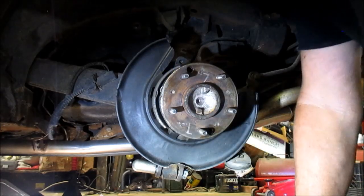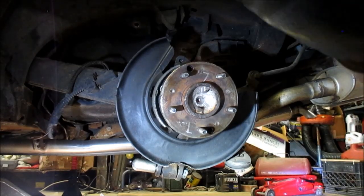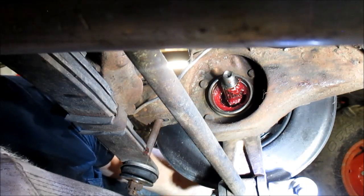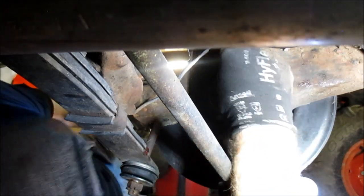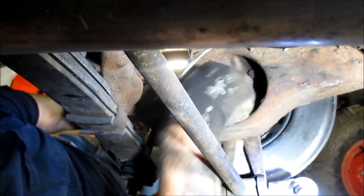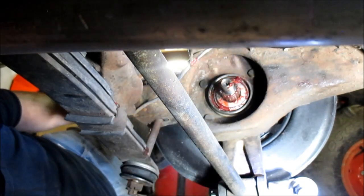All right, he'll just hang there. Now I'm going to go on the inside and put the shim and spacer in, the bearing, and we'll get it pulled in. All right, you can see there he is sticking through. Now we're going to put the spacer and the shim that we've already pre-measured on a previous episode when we set these up. All right. Now we can insert the bearing. Now he'll kind of hold him a little bit.